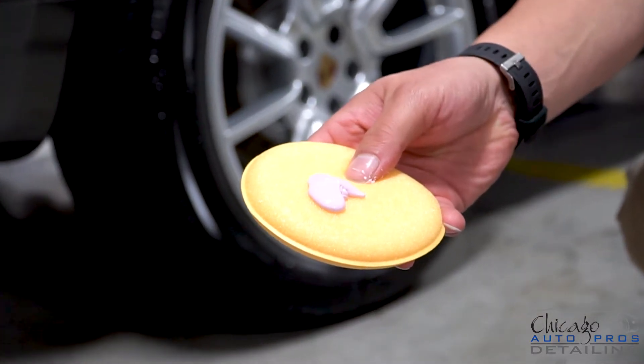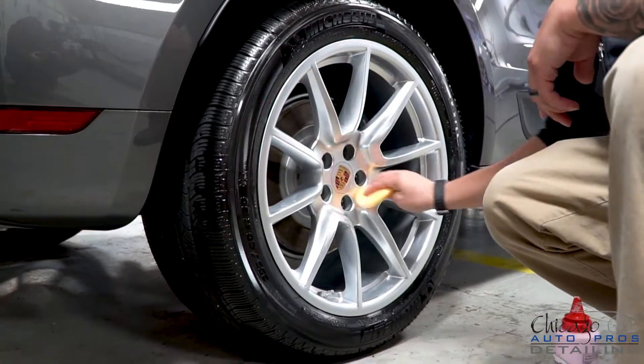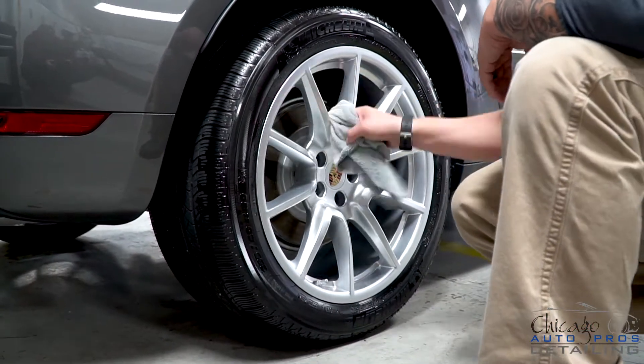The first most basic protection that you can do is a regular carnauba wax. Waxes are simple to use — just apply and wipe the residue off, very similar to waxing a car. This will create a very thin layer of protection on the wheel and you can use wax on most finishes. I would stay away from putting it on matte finish wheels because it might give it a little bit of a sheen. What I don't like about using wax as a protection is that with the heat buildup and the use of all-purpose cleaners or degreasers, you're going to strip the protection off and you're going to have to reapply this wax every time you clean your wheel.